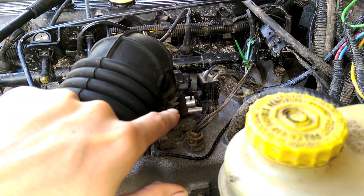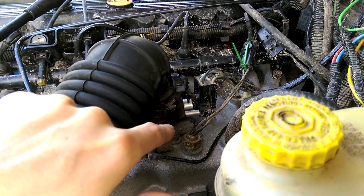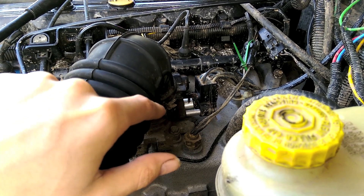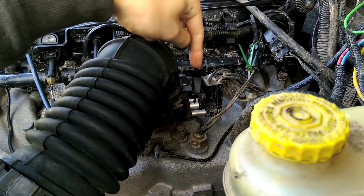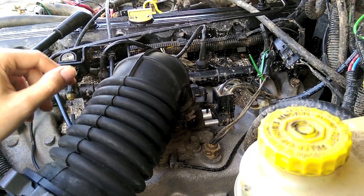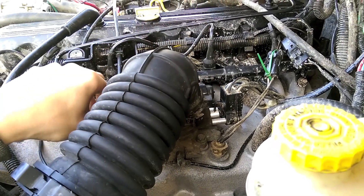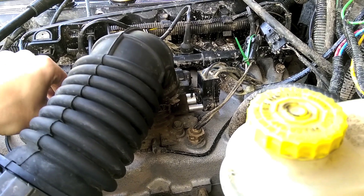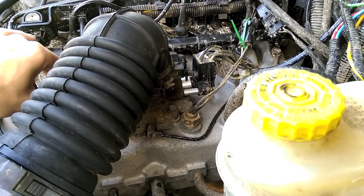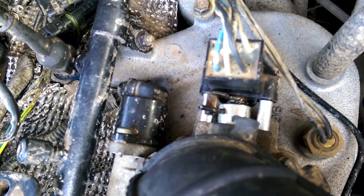The important dimensions: the outside diameter of the inner tube should be 3/8 inch and the inside diameter of the outer tube should also be 3/8 inch. So 3/8 inch is the magic number to fit over that throttle body engagement pin — or key, or whatever you want to call that square thing. Besides that, everything else is pretty easy to figure out. I'll put all the numbers and stuff in the description for everything you need — that's how you make yourself a TPS adapter for $6.